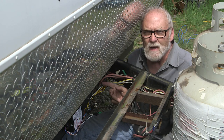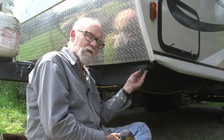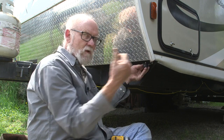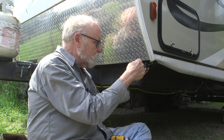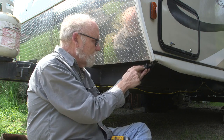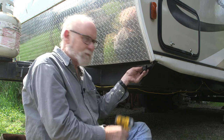From here we move back to the wheels to take care of the brake separation. This is the indicator light that you mount on the far side of the trailer so the driver can look in the rear view mirror — if the trailer begins its anti-sway activity, the LED lights up so the driver gets an idea that something is happening back there.